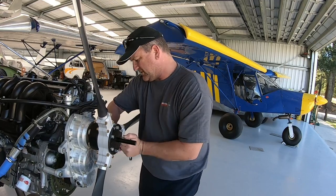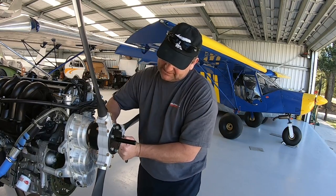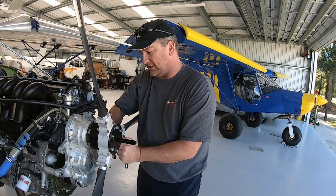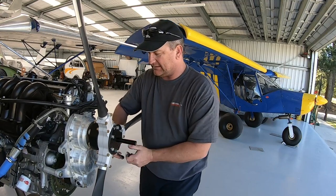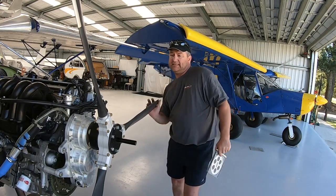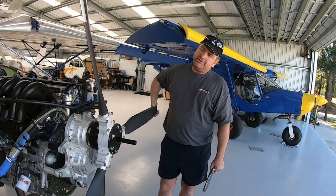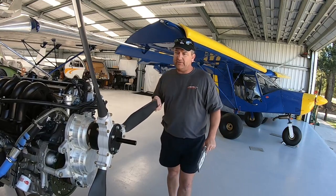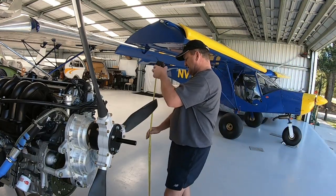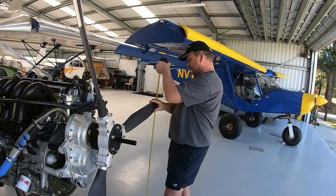In the field, it generally takes me about 15-20 minutes to change my pitch. Like I said, I do it probably a couple of times a year, and it sure makes a big difference when you really want huge performance. But like I said, my 13 degrees is my everyday pitch, and I'm happy with that. It gives me great takeoff performance, as you've probably seen. But with the Viking 130 on, I can still get 80 to 90 knots out of a 701, which is generally pretty unheard of. But big blade, strong gearbox, and an engine with a lot of torque. That's what you end up with.